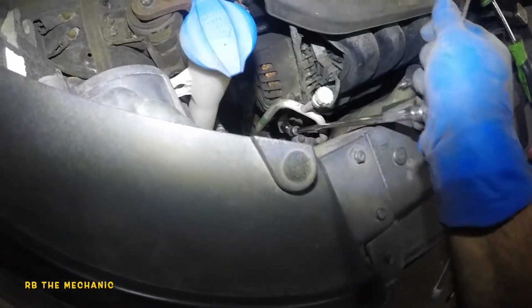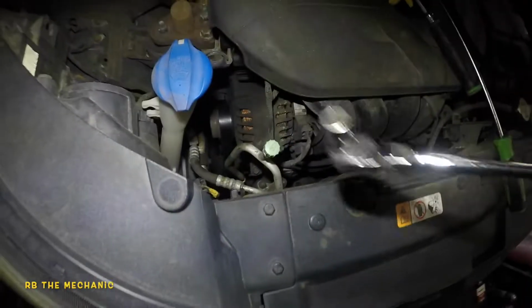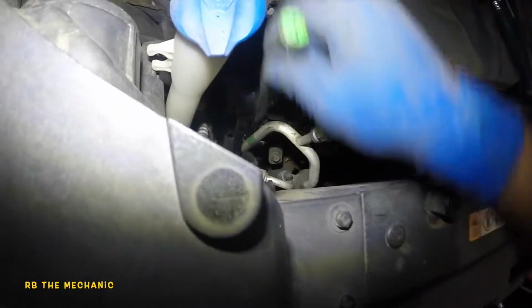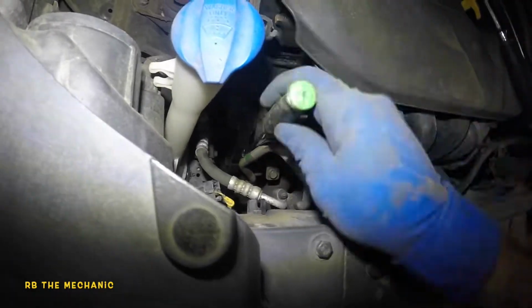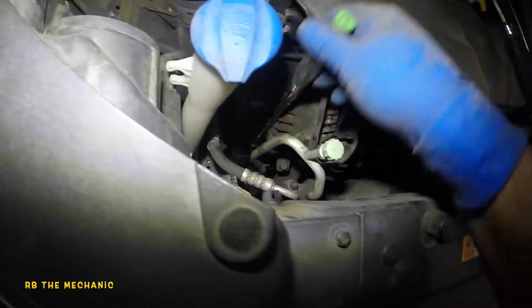Sometimes, like I said, the customer needs to come back and readjust the belt. So this is a done deal. I'm going to switch up my tools. We're going to take the socket and put it onto this ratchet here. Now I want to tighten this, just like a regular bolt. What it does is grab the other bolt and stop it from turning or unadjusting itself. So give this nice tightness. It's small little turns that I'm doing here, but you start to feel the stiffness. There you go. I'm going to leave it there, and it's done.